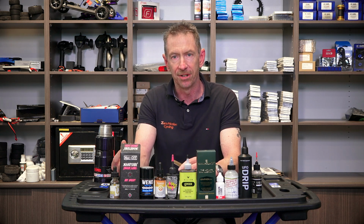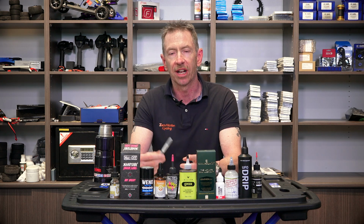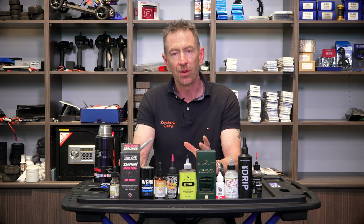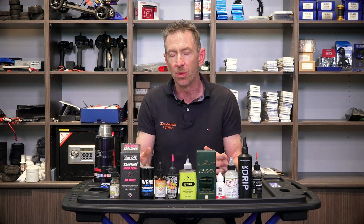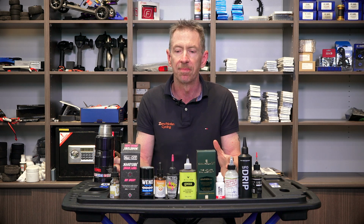So if you've got any kind of wet lubricant on the outside of your chain, it just attracts contamination. And so the UV light is a really big problem with their other lubricants like the hydrodynamic and nano, things like that. Because if you ensure that all of your chain on the outside is coated in a wet lubricant, you will have a grinding paste mess in absolutely no time whatsoever.